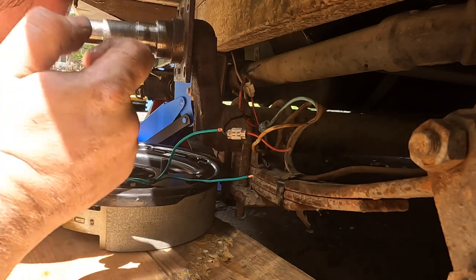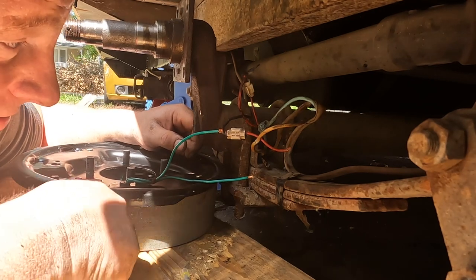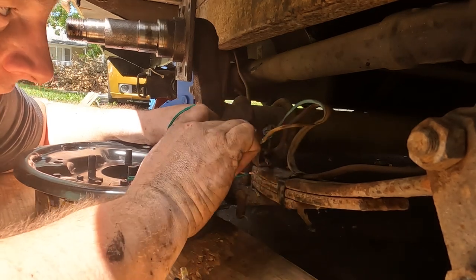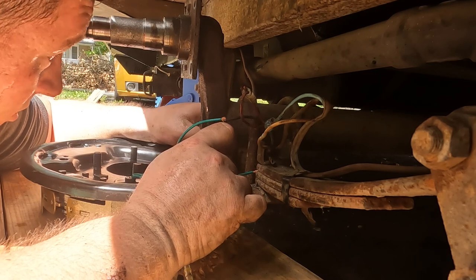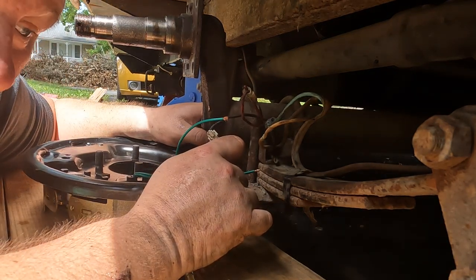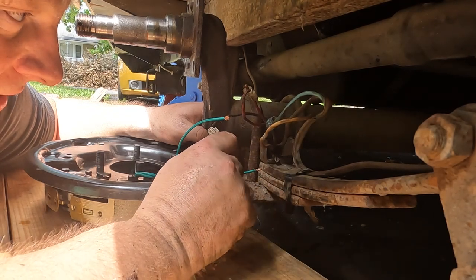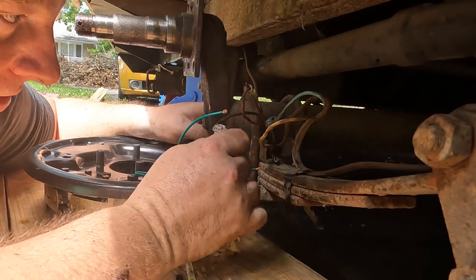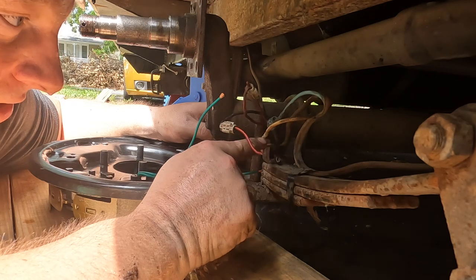This mess is also part of why I'm doing this — I'm wondering if the wiring is what's caused my short. I'm very nervous for what I'm about to do. These thicker wires here are emergency pull-away pin brake wires. These two that come from inside the axle are actually wired to the camper. Truth be told, I have no idea where they go into the axle — it's really confusing to me. If none of this works, I think I'll have to do more research on how emergency pins are set up and wired. Basically I need one wire for each — it doesn't matter which is which because we just need a current. So I need one of the wires that comes from inside the axle — the black and the red — connected to one of the wires on the brake and also to one of the two thicker wires here.